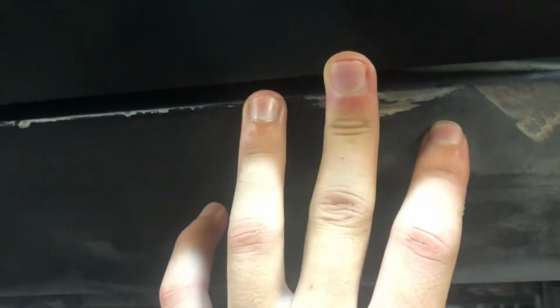So I'm thinking what I can do is put a 2x in there and do like what some people do with the hoods, where they kind of put pressure on to just bend them a little bit. I'm gonna try to bend this lower in just a little bit. Just gonna apply light pressure constantly and just kind of pulse into it a little bit and see if I can get it to flex inward a little. We'll see how it turns out.